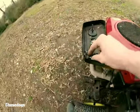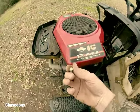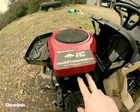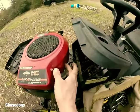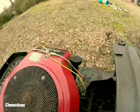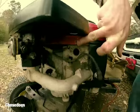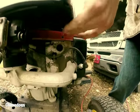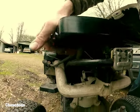What I found is these bolts right here — a 10 millimeter will work on them, but the real size is a 3/8ths. You're going to have one over here, one over here, and then you're going to have the same on the other side. You're going to have two on the back — one over here next to the starter, and one over here by the dipstick tube. You'll also want to remove the dipstick tube. And you've got one more on the right side right underneath the air box, and one more by the PCV valve on the left side of the motor.